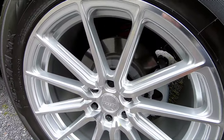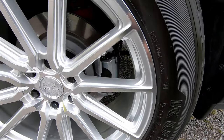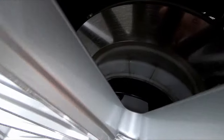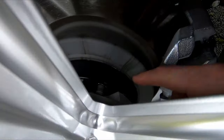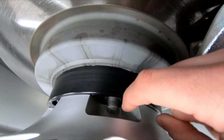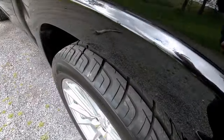My Vossen 22-inch wheels wrapped with 305/45/22s. I didn't like the offset of these with the OEM flares — they stuck in too far. So I opted for some Bora spacers. They are 1.25 inches, and as you can see these wheels have a cutout on them. The stock wheels also have a cutout so you can actually run these as stock wheels too. I could have gone with a smaller spacer, but this spacer got me perfectly flush with my flares.